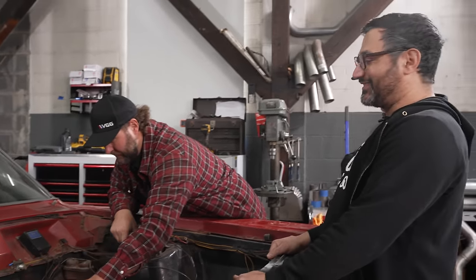Awesome. So the initial issue here was that the factory power steering pump resides here, which has a pulley on it that we're no longer using because we're not using power steering. So I made basically a delete pulley setup. We grabbed a ribbed idler and just stabbed up a little bracket that comes off the cylinder heads. That way we can still use the full serpentine belt setup. Otherwise, it wouldn't be able to wrap all the way around and turn the correct direction.